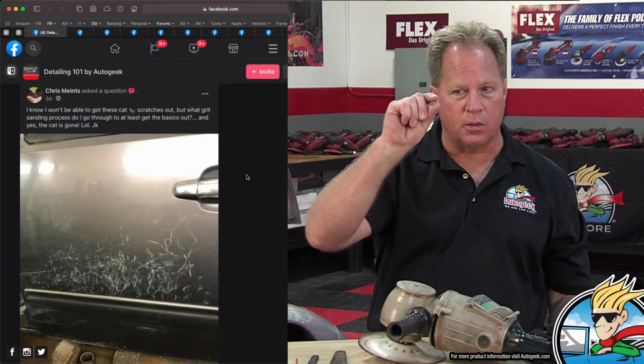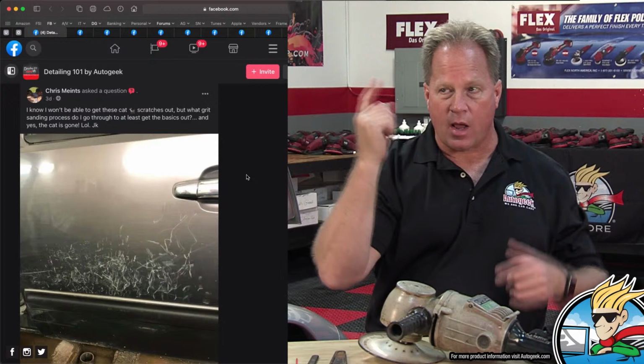Okay, well, this is a topic that Yancy and I cover here all the time, but the factory clear coat is only about 2 mils thin. Grab a post-it note before you start sanding on this. Grab a post-it note, hold it between your fingers. A post-it note is about 3 mils, okay? So your brain can wrap around the fact that the clear coat's thinner than a post-it note, and you're gonna go, wow, that's really thin.